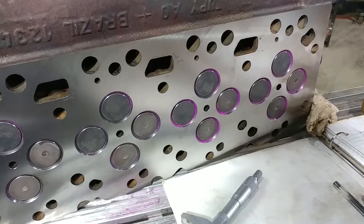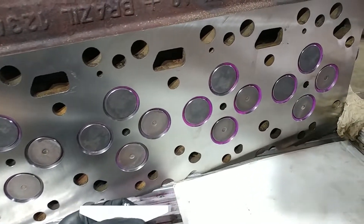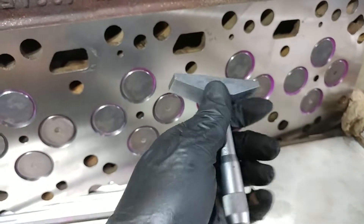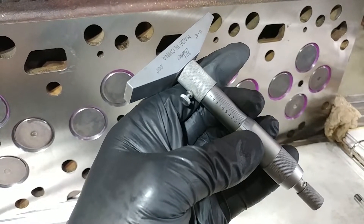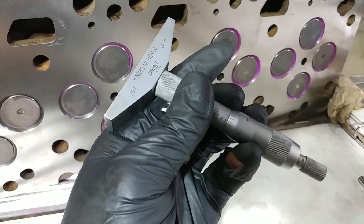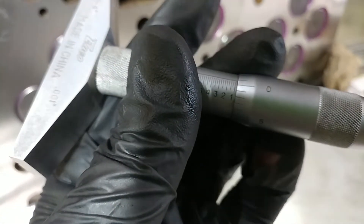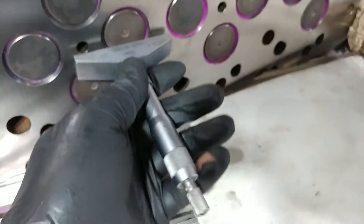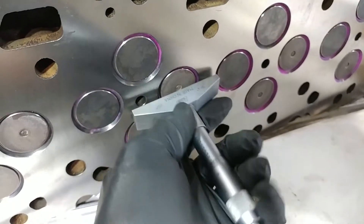That's what they're asking for off the top of my head. We've done all 24 of these valves. What we've got is this depth gauge, and you can see that is 100 thousandths right there. If we roll it back, this is in increments of 25 — so that would be a little shy of 100 thousandths, one full rotation shy, which would be 75 thousandths.